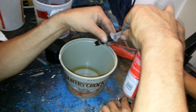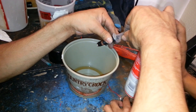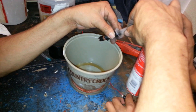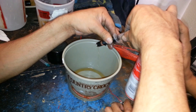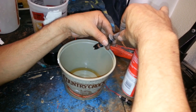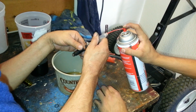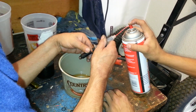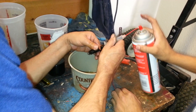What we're going to do here is go ahead and press the momentary switch and the sprayer to open up the injector while we spray it. There you go — that should clean it right out. Now all you've got to do is flip it and do it in the other direction. We're now pushing the carbon cleaner in the other direction — put it right where it was sprayed.